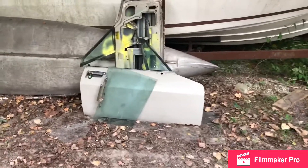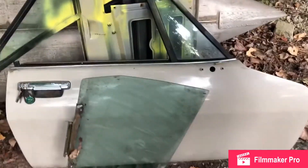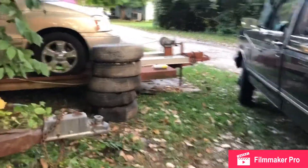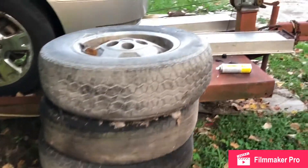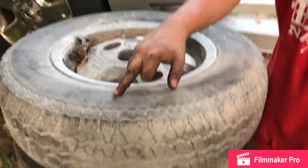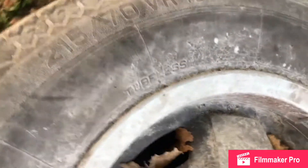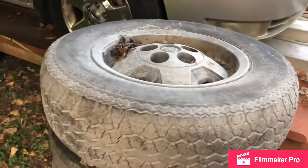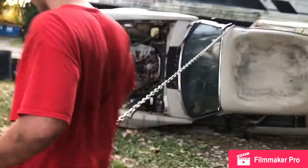The doors are over there — as you can see there's a wasp nest here, there's nothing good about these doors. I've cut them out, they're junk. We have a full set of XJS wheels over here in perfect condition — this one is still actually holding air. They are 215/70 R15s — there's the size right there. These are Pirelli's — actually good brand, of course they're over 30 years old and they're flat, so you will need new tires.